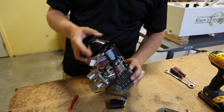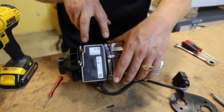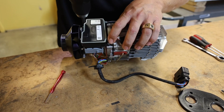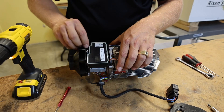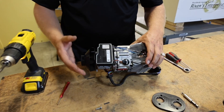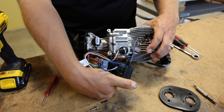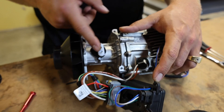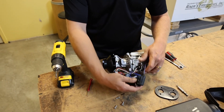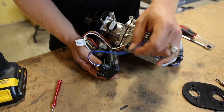Now you're just looking at the burner itself. The ECU control unit has one, two, three screws, so go ahead and remove all three of those screws — they're all the same length so you can't mix them up. Once you've removed the three screws, the ECU pulls directly up. Just slide up and tip off to that side. These pins are what it came off of, so when you go to put it back on, make sure you get them nice and lined up, and when you're pulling it off, don't pull it off one way or the other. First thing I do is remove these wires out of the little retainer clips on the back of the ECU by just pulling them out.